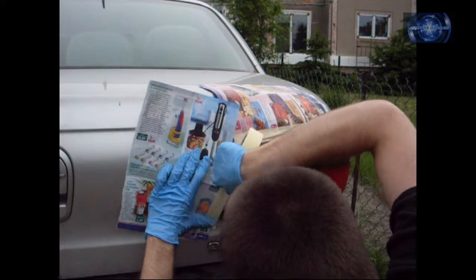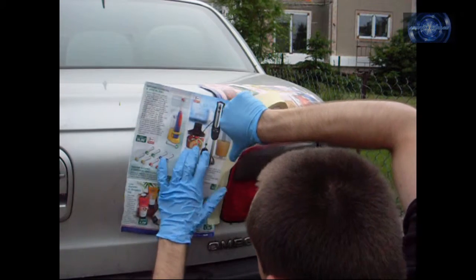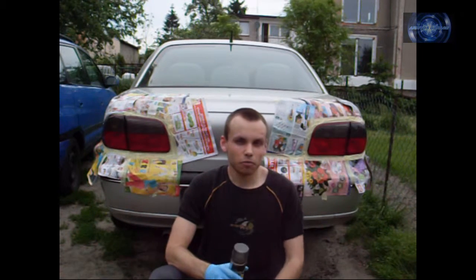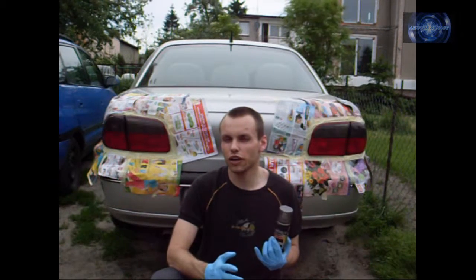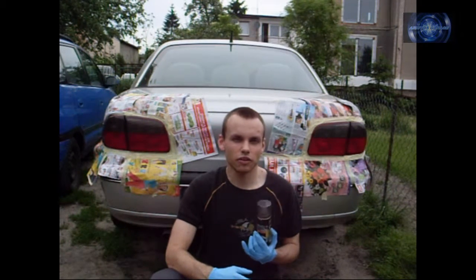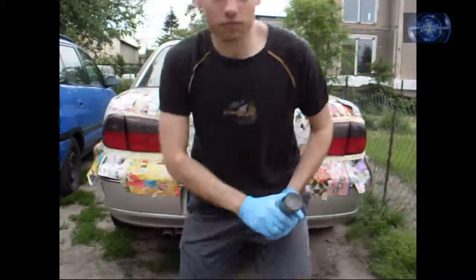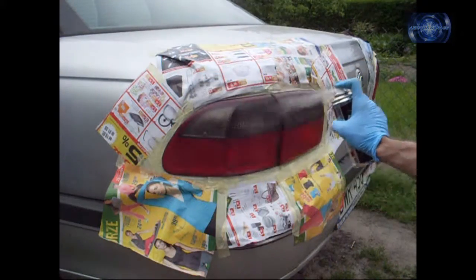Now mask the areas all over the taillights. I'm not going to black them out completely — just a little bit of smoke. If you want them much darker, just put more layers. I'm going to put one, maybe two soft layers. Remember to always put the same amount of spray paint on both sides so you won't get one taillight darker than the other. Remember to put only light layers a few times rather than one thick coat.